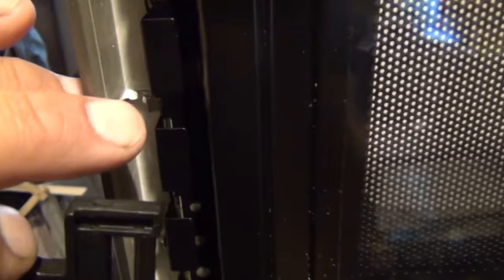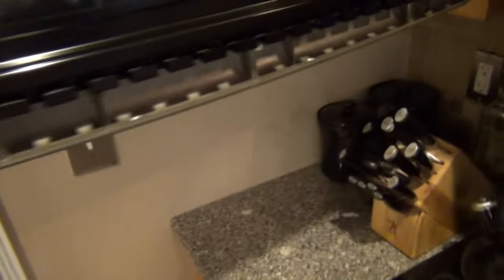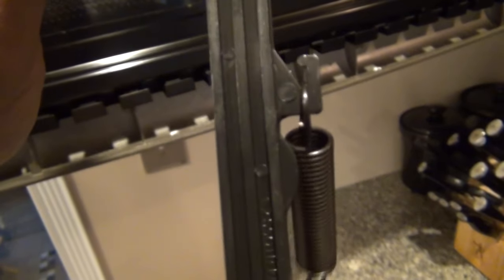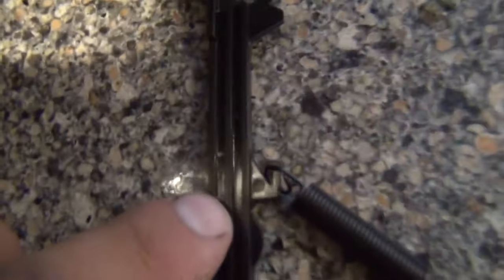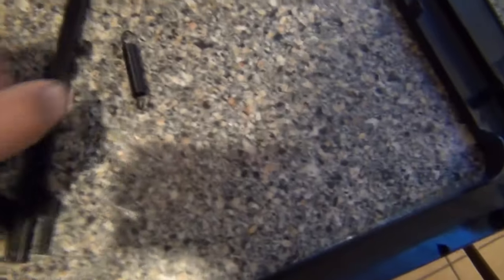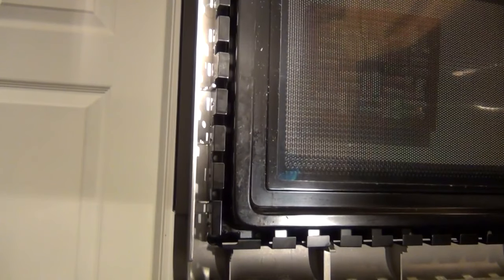You need to rehook this spring on a different portion of the door. If you have that broken piece of plastic, don't try to glue it back on — it's just going to break off again in a short time. Just hook the spring on a different part of the door. The other 1% of the time, the tab on the latch itself breaks off — if that happens, just drill a small hole somewhere on the latch that you can hook the spring through. Again, don't try to glue it — there isn't any glue strong enough to hold it together.